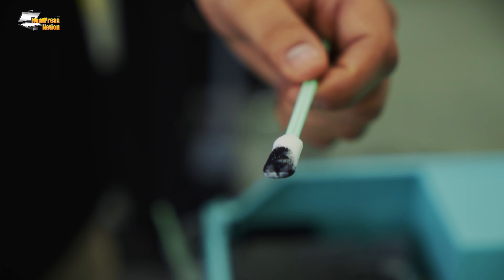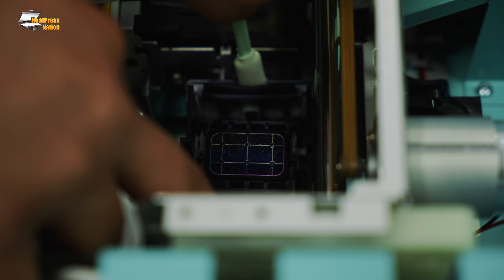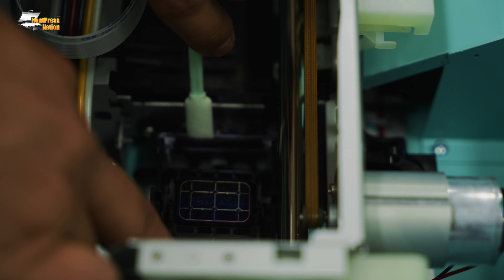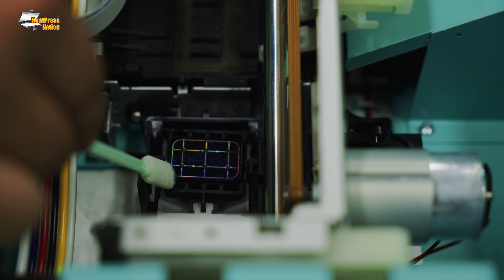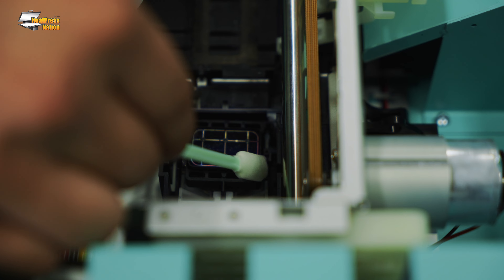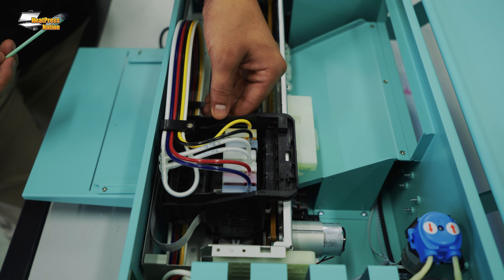This should be nice and clean. If it looks dirty, you probably haven't been doing your maintenance enough. So again, this is end-of-day maintenance — we're going to clean around here. Let me get a clean swab and go over it one more time. Much better — just very little ink, which is what we're looking for. The second thing is we're going to clean around this capping station right here — we don't want a buildup of ink. Then we're going to slide the capping station all the way back over.